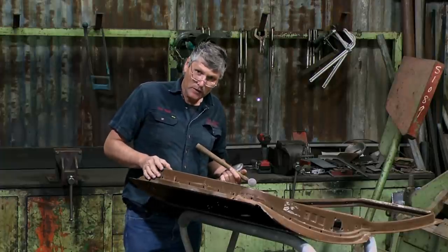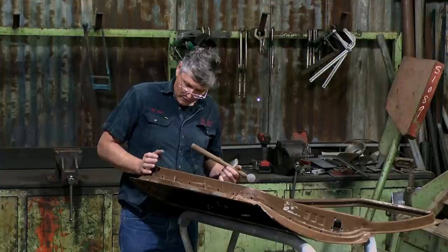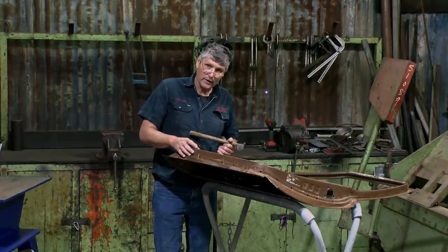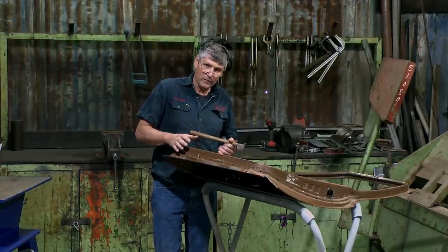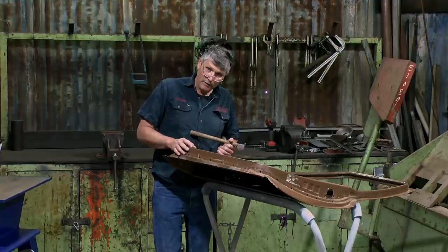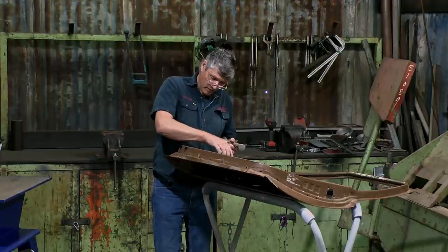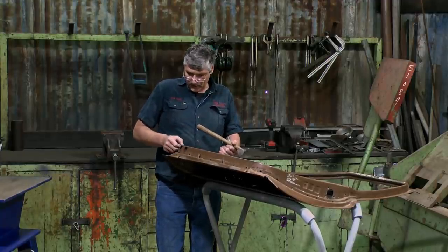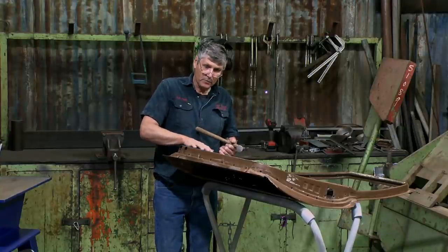It looks like they've been in there with the air chisel and curled a whole heap of metal out there and really made quite a mess. What I'm thinking now, looking at the amount of rust I've got around it, I might be better off on this particular door to see if I've got a salvage part from another car. I've got several old cars down in my graveyard that might have a piece — even if I can get down to this line and maybe into this corner a little bit, that way I can replace this whole area where the speaker's been.